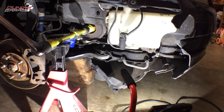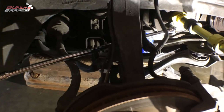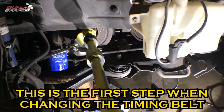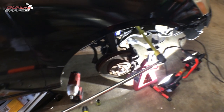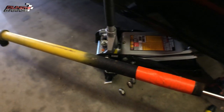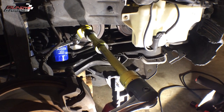Got my cheater bar for the three-quarter-inch breaker bar — that was it, it broke loose! Let me show you the setup. I have a half-inch breaker bar locked into the lower control arm on the crankshaft pulley tool, going into a 19 millimeter three-quarter-inch socket, then extensions bringing it down to the three-ton floor jack. I have my three-quarter-inch breaker bar — I'll put links to all this stuff in the description — and I have my three-foot cheater bar that I found in a field near my old house, and it's awesome. These bolts can be a real mother sucker, so just be prepared to go to war, but at least I got this one loose.